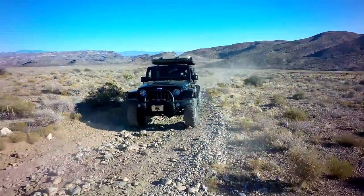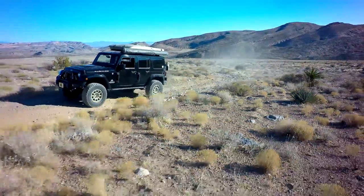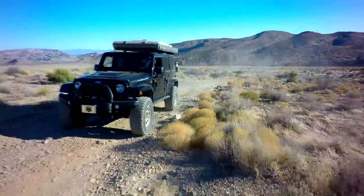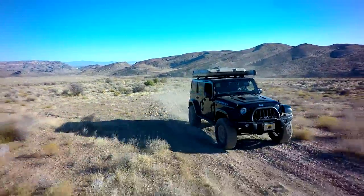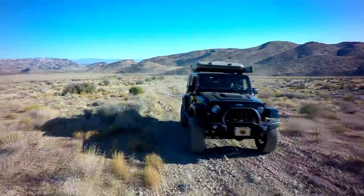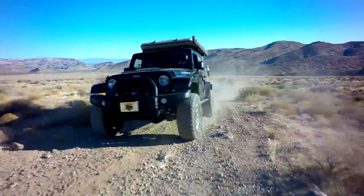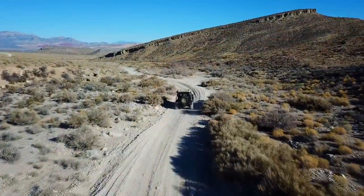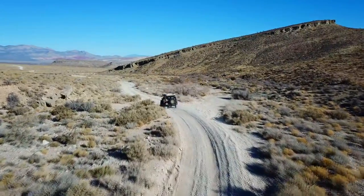Who knows what we're going to see — 8-speed transmissions, 10-speed transmissions, and I've even heard rumors of overhead cam engines. We're using our billet drive brackets, and they have really taken a lot of the load off of the swap. Not having to run the GM accessories, modify things, and run custom lines has really streamlined it. Plus the billet brackets look awesome. And when you look at our EZ engine mounts that are bolt-in, they've taken a chunk of labor out of the swap. Being able to drop your motor into the frame with no modifications means you can more efficiently do the swap with the body on. I'm calling this a reversible swap because literally you could take the V8 out and put your V6 back in if you wanted to.